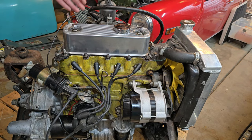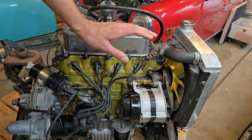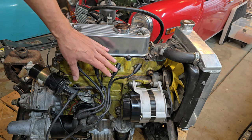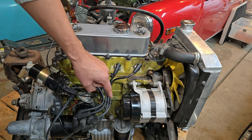So where does this pressure come from? It comes from the fuel. As the fuel comes from the carb, goes into the cylinders, gets ignited by the spark plugs, it generates pressure. That pressure pushes the piston down, generating motion of the crankshaft. Since the system isn't perfect and not all the gas pressure is contained by the piston, some of it escapes down into the crankcase.